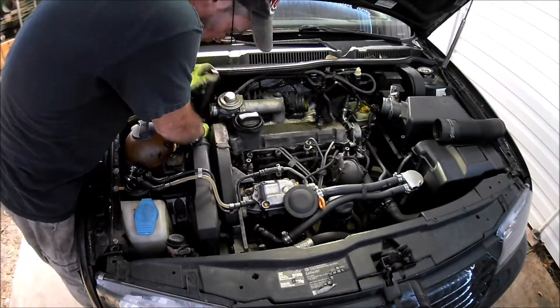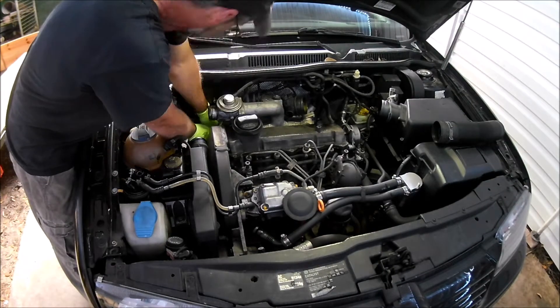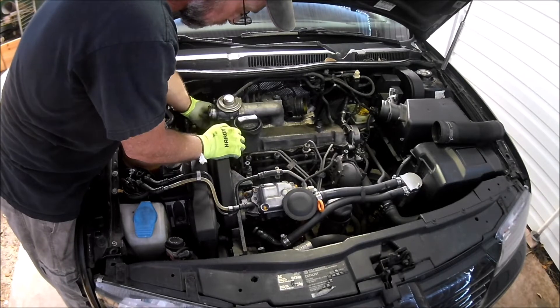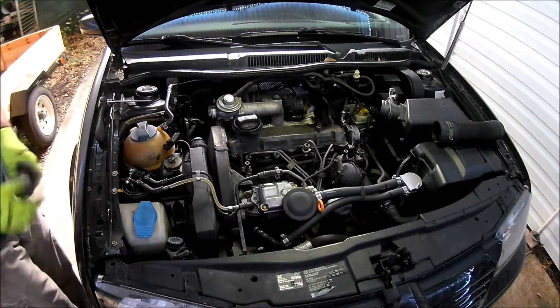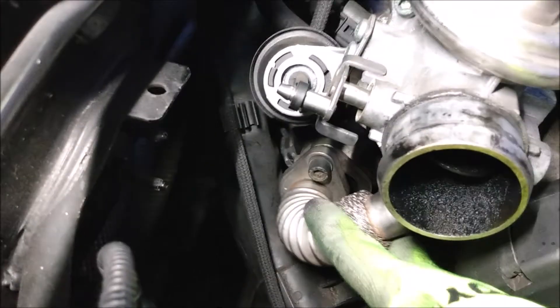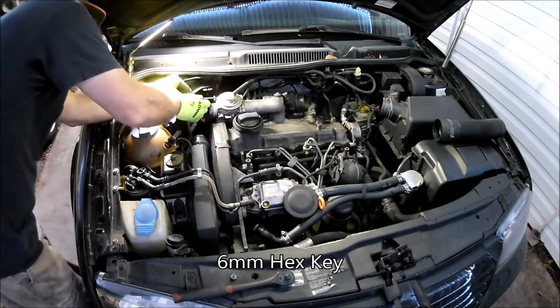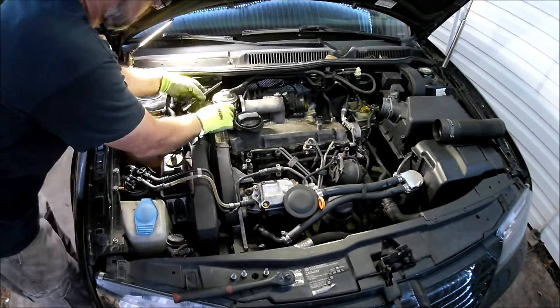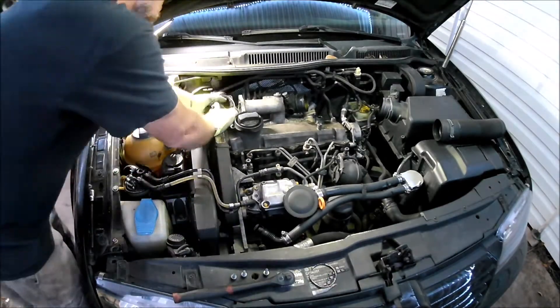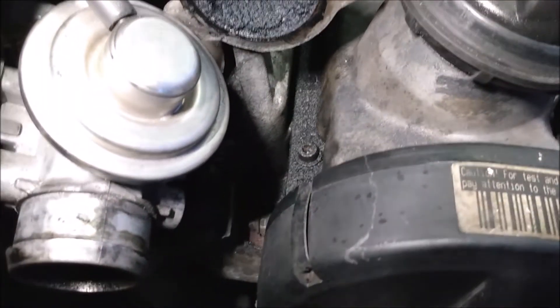The EGR pipe underneath the EGR valve needs to be removed first — it has two bolts on either end of the pipe. Space is really tight in there so it was difficult to get the camera and a light source in there. Now that the pipe is out of the way I can remove the EGR valve; it has three mounting bolts. By the way, the EGR pipe has a gasket on each end that might fall out when you remove it. Also, the o-ring seal fell out of the EGR valve when I removed it. After I detached the EGR valve I just moved it to the side — I just need enough room to get at the one valve cover bolt. Now I have easy access to it.